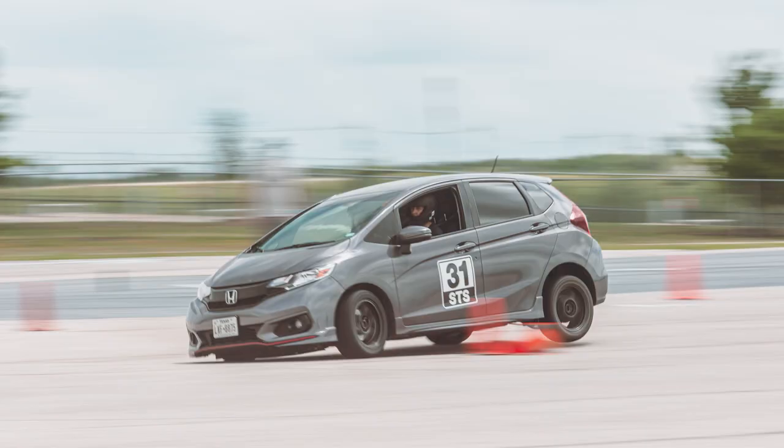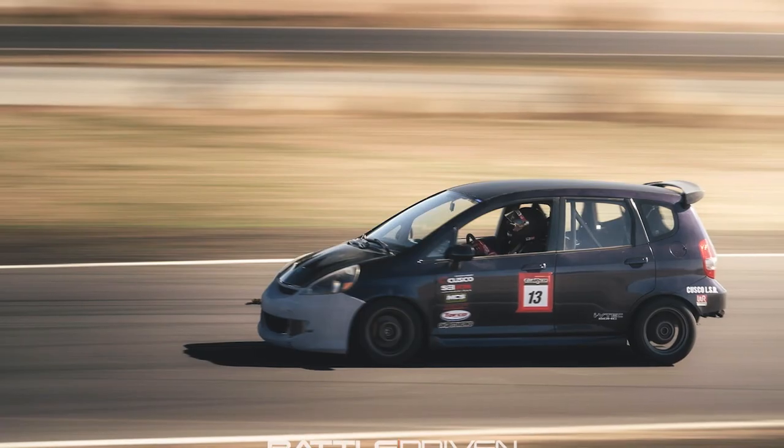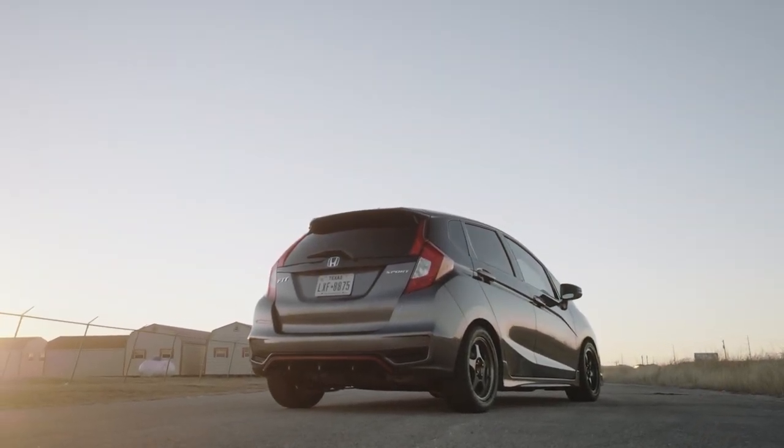My overall thoughts for setting this car up: spring rate is probably one of the most important things. If you're on 200 tread wear tires, which most people are if they're serious about autocross or track, you need a lot more spring rate than is offered by stock, HFP, or any of the lowering spring companies. The spring rates just aren't enough to get the most out of the car — a lot of fast guys are doing 10k or 12k springs. Engine modifications basically don't matter in this car. If you spend a thousand dollars on full bolt-ons, that money is better spent on suspension and tires. If you have any questions, post them in the comments. I'm probably going to do some more Fit videos soon. I'll see you next time.